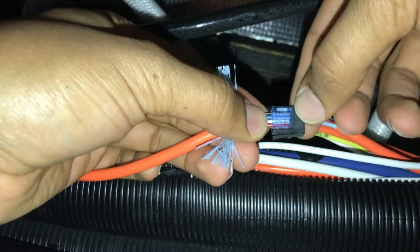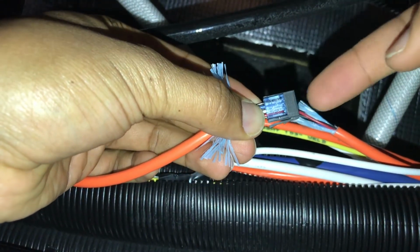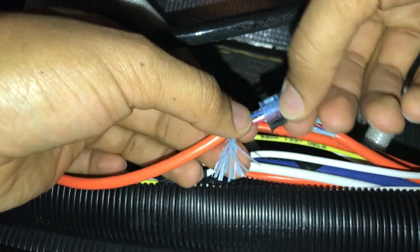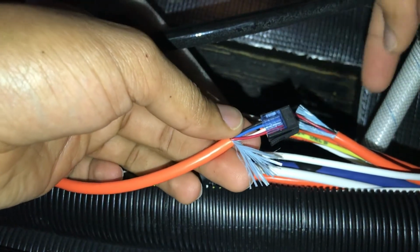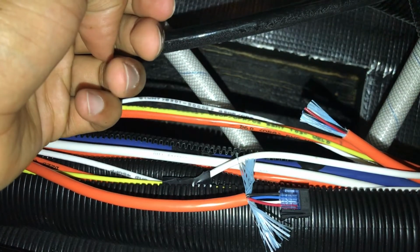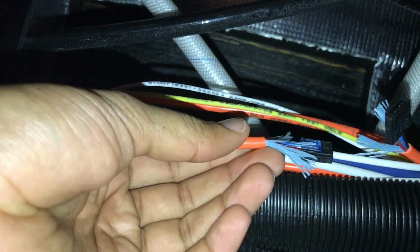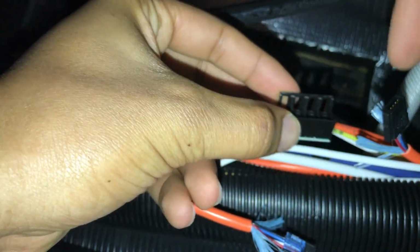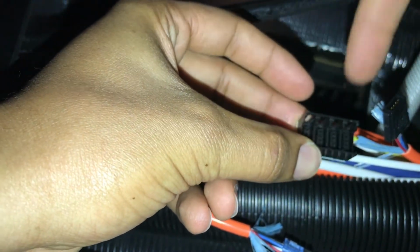And once you've verified that the connector is crimped all the way flush, then you want to proceed to the other end of the cable and perform the same action on that side. So now that you have both ends of the cable that you cut terminated with mini clamp connectors, you're going to plug each end of those connectors into this Spyder G4 common drop tap.